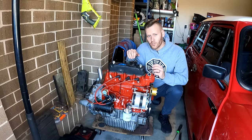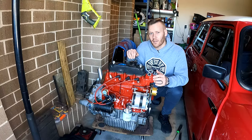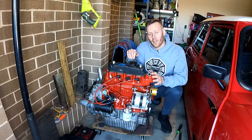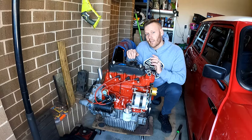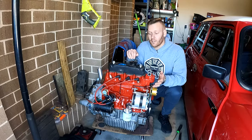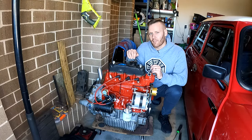You want to be checking the engine oil level — pulling the dipstick tube out and making sure there's oil in there. You also want to check things like your power steering fluid and coolant. Get them changed as early as you possibly can to help prolong the life of the engine. The oil may look clean from sitting so long, but once you start turning that engine over, if it's not lubricating and cleaning the internals like engine oil is supposed to do, you're going to have a bad time.